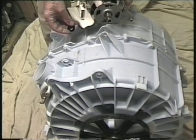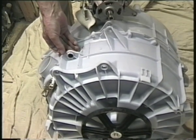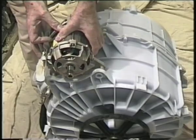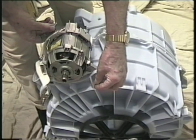This little bush sits on the rear peg of the motor and must be replaced when refitting. It's far easier to refit the motor while you have the container out like this than when it's in the cabinet, because it's easier to slot the motor in from the top rather than hold it up from underneath. Once it's in place, refit and tighten both bolts, but remember to fit the washers first.